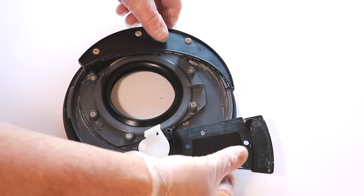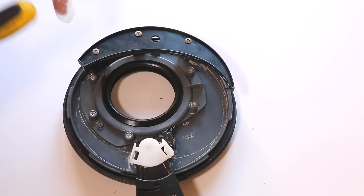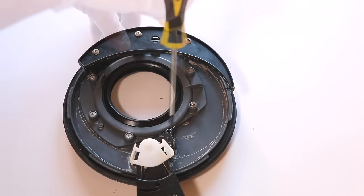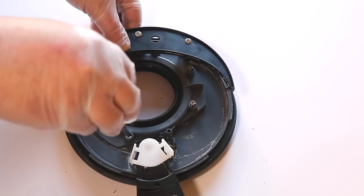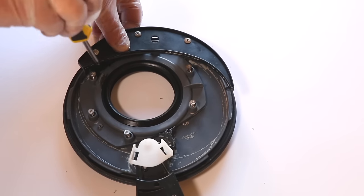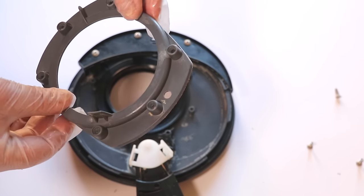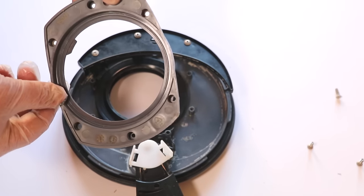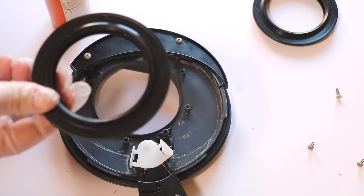The second task once the blade is removed is to gently rotate the swing arm all the way around so we finally have access to the seal retaining cover. With access to the seal cover we can now remove the six screws which hold it in place. Unscrew and remove all of them, and it's a great idea to clean this cover and the edges of the lid as well. This will ensure that the seal fits nice and flush against the plastic parts when refitted.